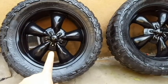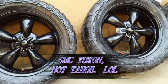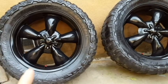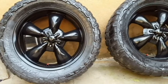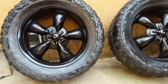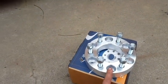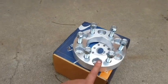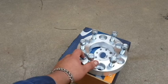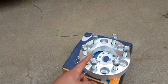You guys recognize those rims — those are six by one thirty-five. But we are going to install them on a Tahoe, so obviously these are not for Ford but the lug pattern is for Ford. The person that got these rims has his Tahoe lifted and wants to put those rims on with the tires sticking out a little bit. So I told him we need spacers. Those wouldn't fit on his Tahoe anyways, but now they will because I ordered the spacers with the different patterns. It'll bring the rims out one and a half inches and then the rims will fit on this lug pattern.